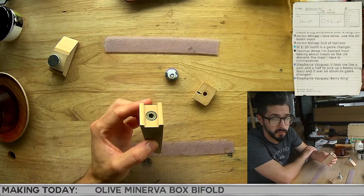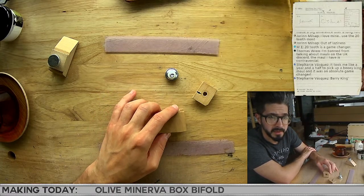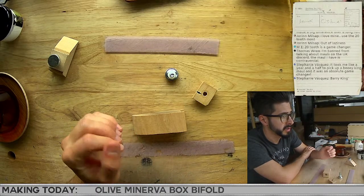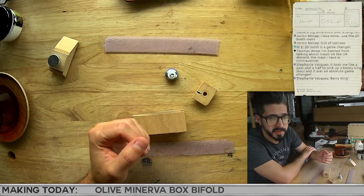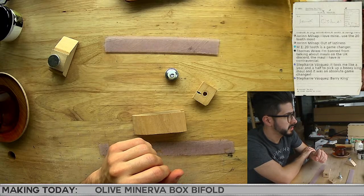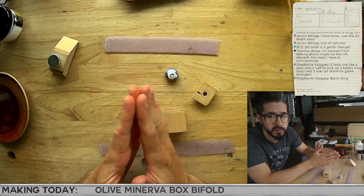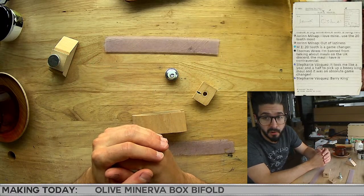When you're block sanding, for example, when I would wet sand a car, I'd use a medium soft block behind that. Or if you're block sanding a build primer or something like that, I would use a hard block, a long block for that. And the reason is that the surface of your hand will conform to small high and low spots on surfaces of cars and things like that.